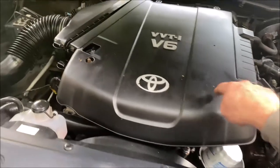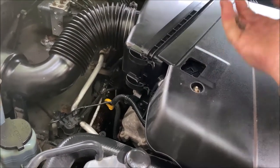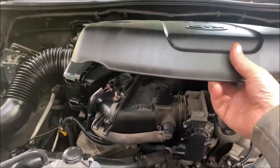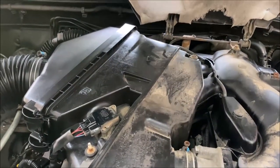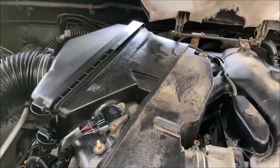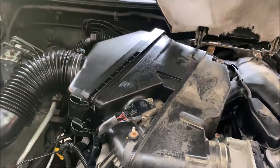There are 10-millimeter acorn nuts on the top of the engine shield cover — conveniently loosened already. Lift on the front and pull. You'll see there are two little feet on the bottom; those go under two little circular rubber grommets at the back. It just goes on there and rotates back on, so this part goes off and on first.